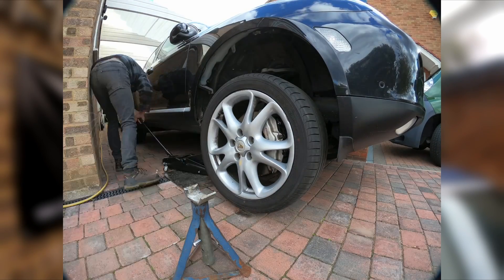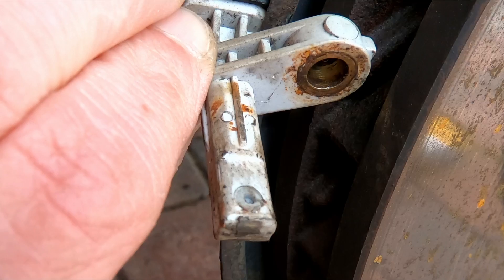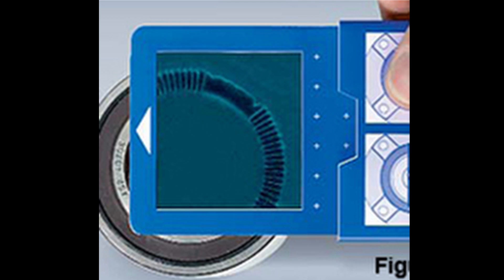Secondly, he's explained to me how that pickup works — and it's not, as I totally incorrectly assumed, a reluctor ring with a sensor. It's actually a magnetic ring in the wheel bearing, and the sensor picks up the change in the magnetic field. So if the magnetic field in that ring has been damaged, that would be the reason why I've got this erratic signal. He also suggested checking the sensor for signs of contact with the bearing. Until now I was unaware that you could get this magnetic ring in the bearing, or that there's a tool that allows you to see the magnetic field — so I've ordered one of those.